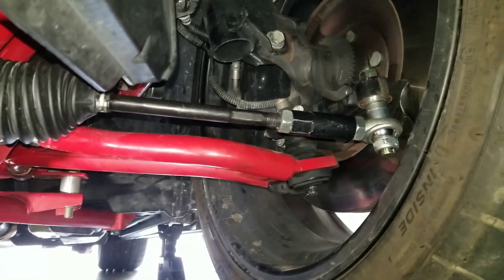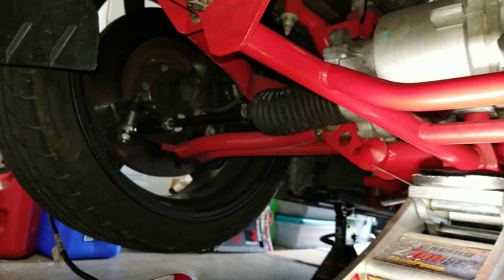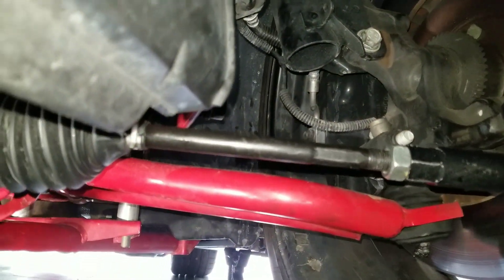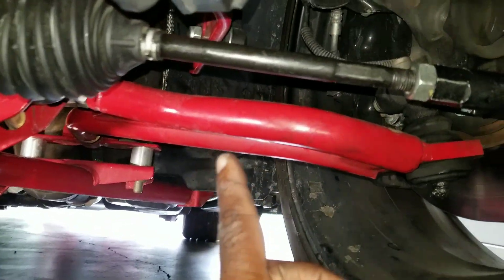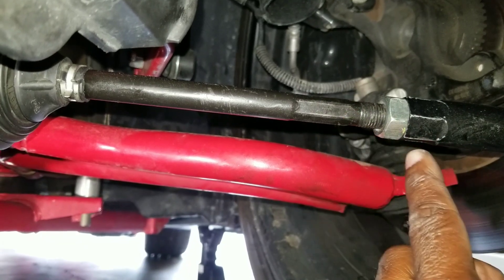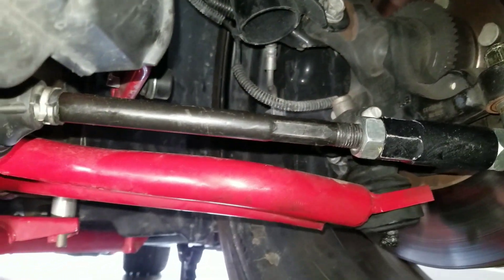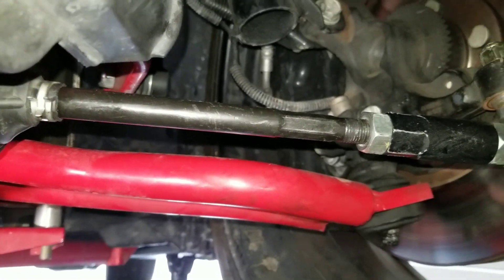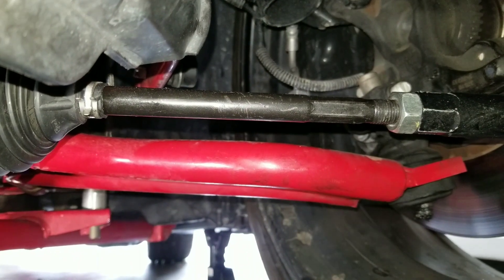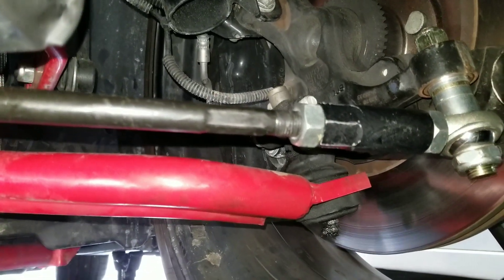All right, so here are the Maximum Motorsports bump steers — they're installed. The problem they were having, which my old mechanic also had when trying to do my other bump steers with the BMR setup, is that the tie rod was either too long or too short. They had to cut something down to get more room to add the bump steers. I bought an extra set of lower inner tie rods just in case, but they ground them down and re-threaded them and got it to work.